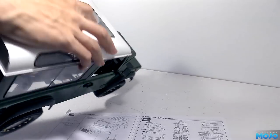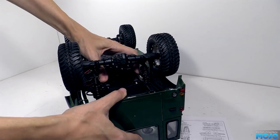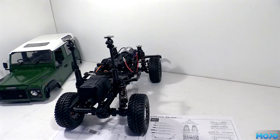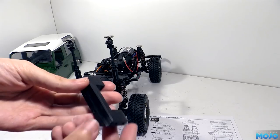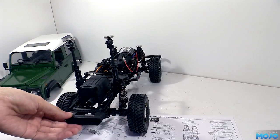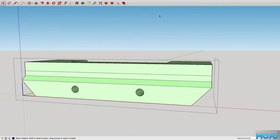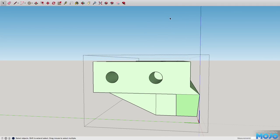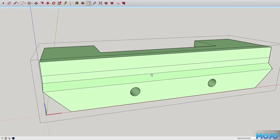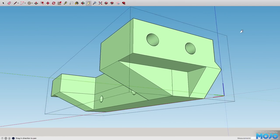Back to the rear bumper. The back end of the chassis ends up almost exactly flush with the bottom edge of the body, so the mount will need to drop down just to the right level, with a millimetre or so gap between the bumper and the body to allow things to move around a little bit in use. Here's the widget — it's in black so it's not that easy to see in the video, so here's a quick look at it in SketchUp. It slides into the chassis rails just like the stock brace using two screws per side, tapped out to M3. Further down there are two holes that line up with the holes in the bumper, also tapped to M3. The rest is just a bit of reinforcement and a slope so if any terrain manages to get up in there it'll cleanly slide off.